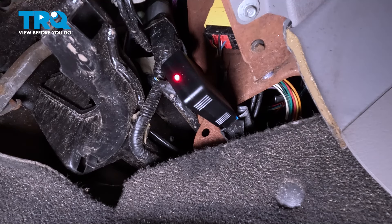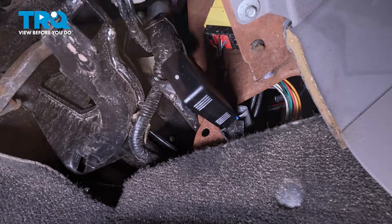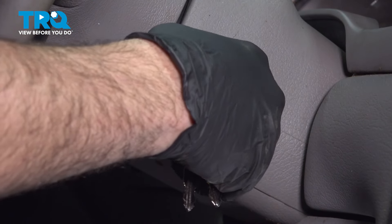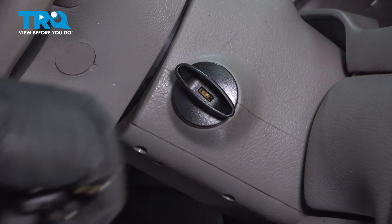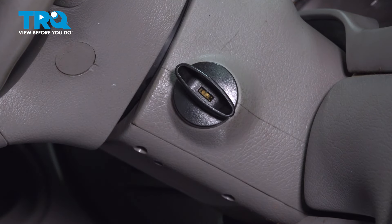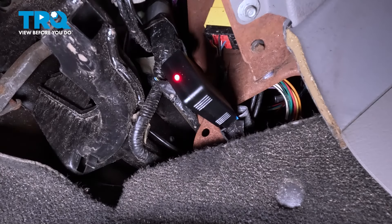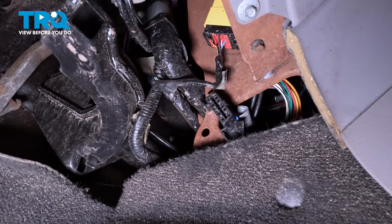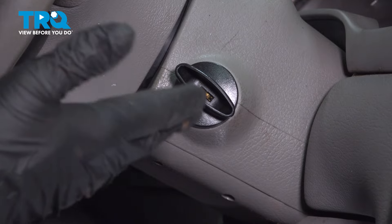We have the slow flash and the beep came on. We're going to turn the ignition back, turn it forward, turn it back, and then remove the key. We're going to wait 90 seconds and wait for another beep — it should beep twice at that point. There are the two beeps, and we are programmed. Reach down, remove the controller, and at that point you're all set.